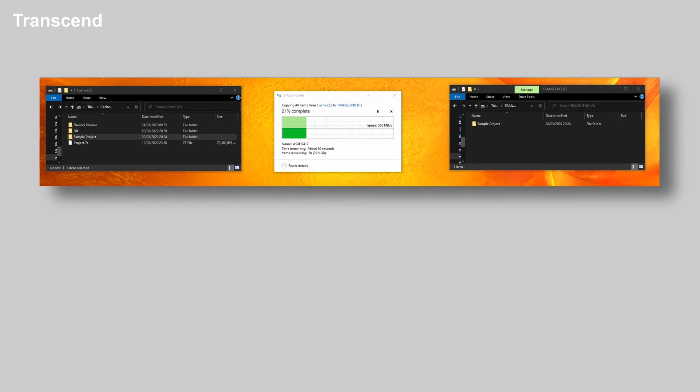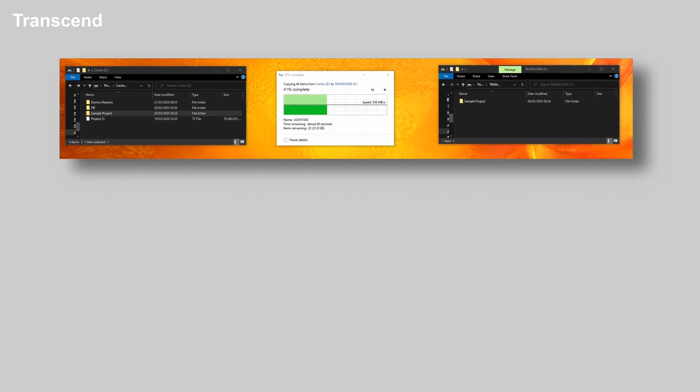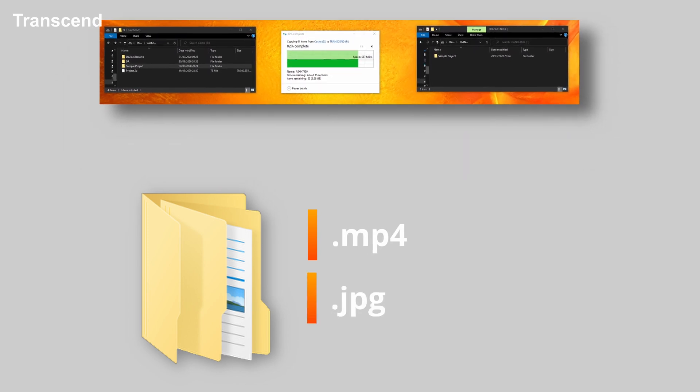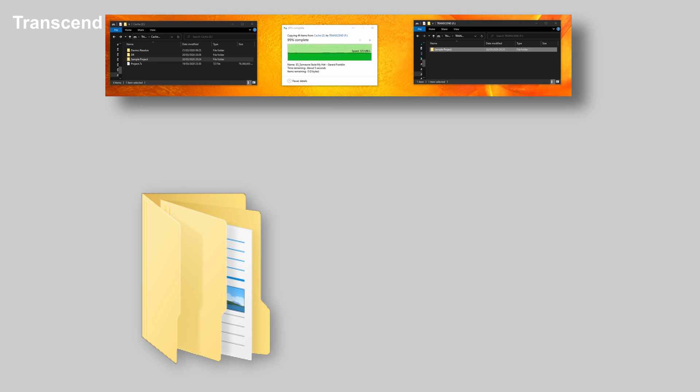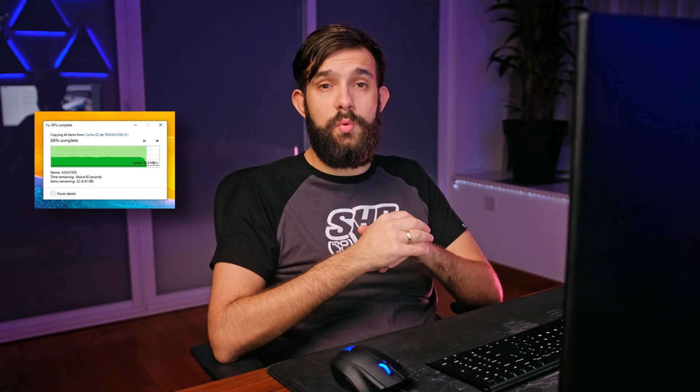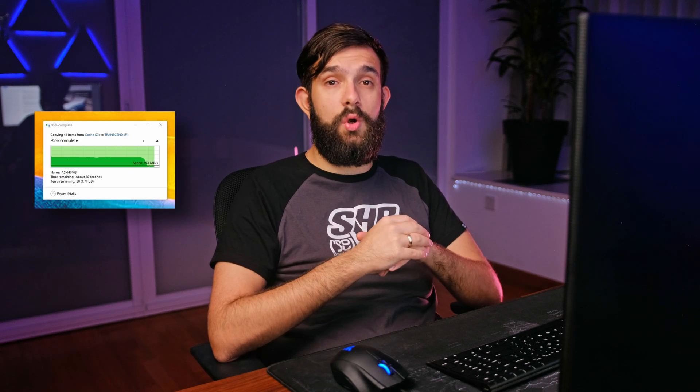So let's give it a test. I copied our sample project folder — about 36 gig, a mix of video files in various sizes and some pictures. I took a break of about 5 minutes between each transfer and repeated the test. The drive got hot but speed stayed at about 550 MB/s. After four rounds I shortened the wait to three minutes, then to two minutes, and towards the end the speed dropped — the cache wasn't able to recover fast enough at those shorter timeouts.